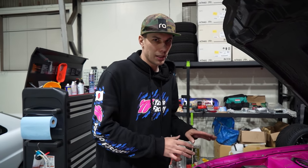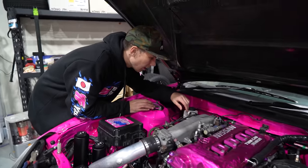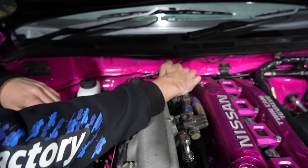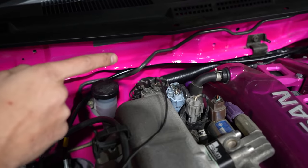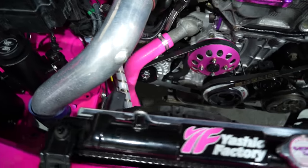But yeah, I'm gonna get started on wiring. Khan's gonna start getting knuckles and brake stuff sorted out. Let's get into it. So I've got a trigger wire laid out here for temporary purposes. I've got it in the auxiliary output from the O2 plug that's here, and it's just running into the relay down there. So it seems to be working right now, but I found a problem.